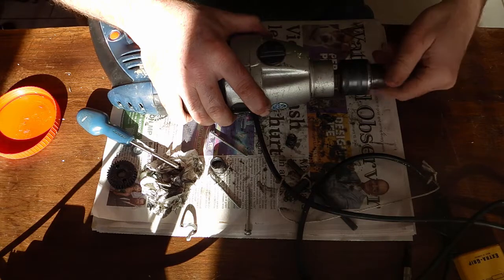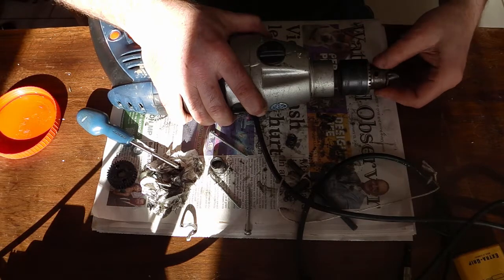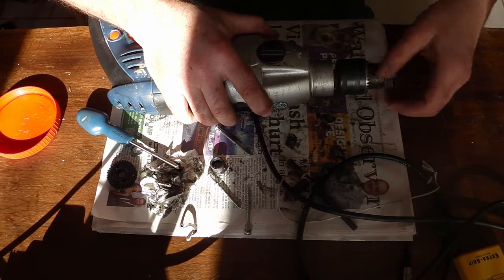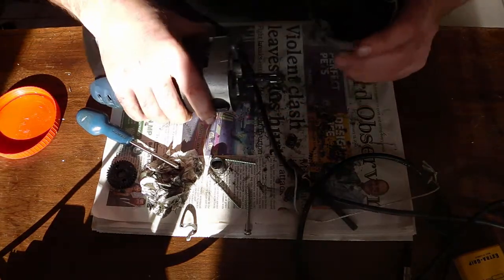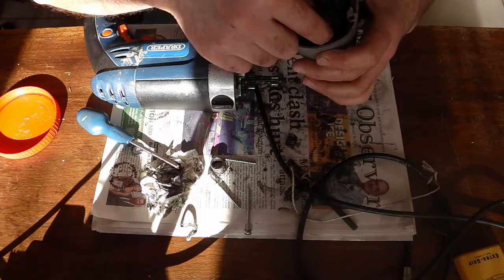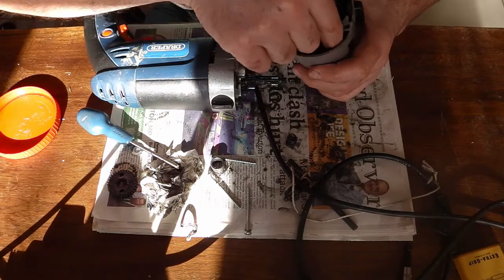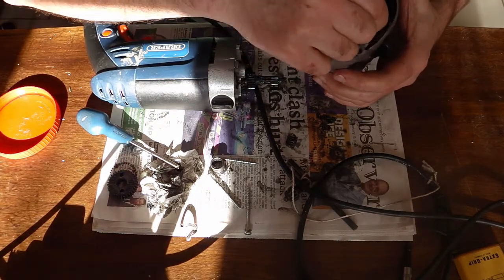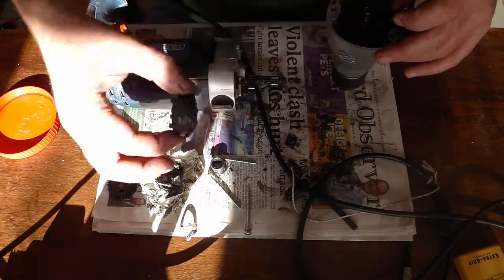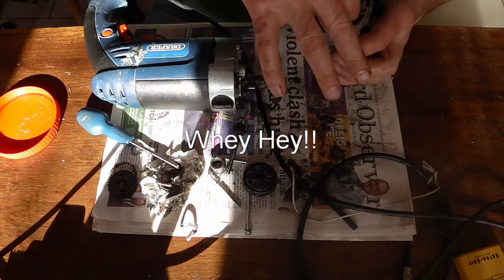This is in high gear and it spins freely. The reason it spins freely in the high gear is because I've taken the small cog out. So I think I've actually got it backwards - it's the lower cog which isn't engaging properly, not the upper one. So I need to put the spacer at the bottom. Let's get that out and have a look at what's down there.